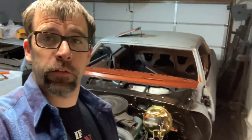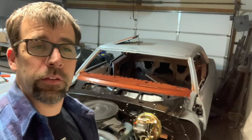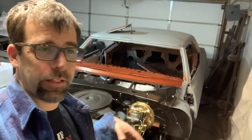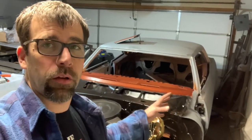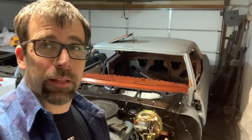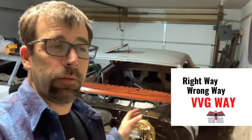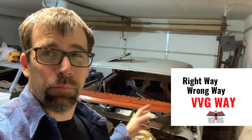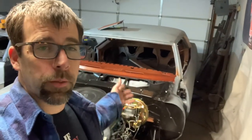So there you have it — we have successfully boosted a Firebird. These lines all need a little bit of massaging, bending them around. I like to get them all hand started and trying to force one really into place, kind of get them all going. Next thing is bleeding the brakes out and filling it with brake fluid. Some people like to bench bleed — your opinion, your thoughts, however you want to do it. We call it the right way, the wrong way, and the VVG way.